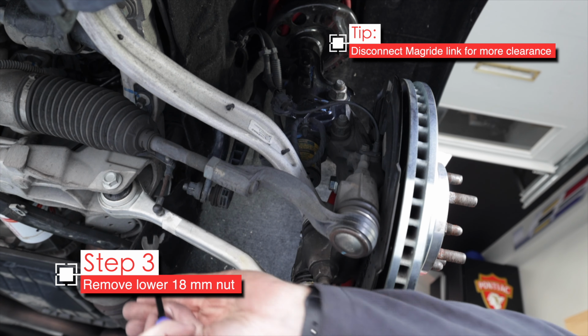Now you might be wondering, well, which is the right side and how does it go? Well, it helps here is right here. Look what it says. Strut side forward. And then over here in this little hole down here, it says stab bar side. So stabilizer bar side. And then right up here, there's an LH for left hand. So this is the left hand one. Take your nut, get it started on there, at least until the center bolt starts to turn. Then we'll get the other one in.